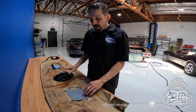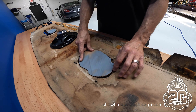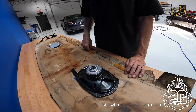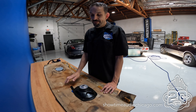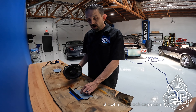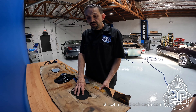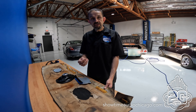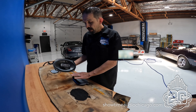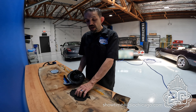On top of that, these are the speaker holes, and somehow they thought that putting cardboard, taping it, and placing this on top would sound fantastic — that's not right. Even if the tweeter did play, you're not going to hear it through the cardboard. And this thicker carpet is not the transparent kind that lets sound pass through. So even if they had spaced it correctly and skipped the cardboard, not much sound would make it through this material.